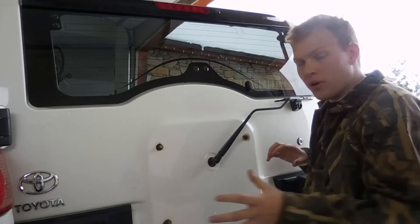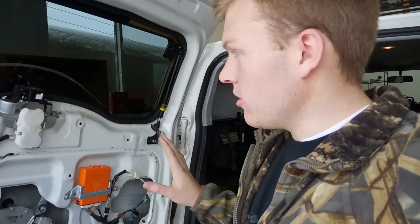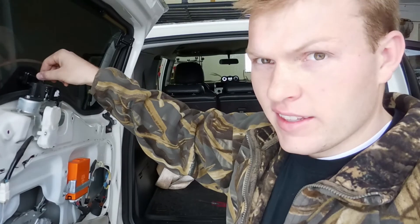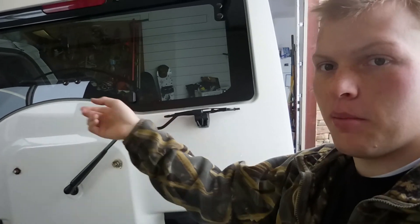From this point, I would take off the bolts and re-put on the rear tire. I would also make sure to re-install this plastic, putting it all back into its place, and then re-putting on the back panel and clipping it into place. Something I forgot to mention earlier: to take it off and to put it back on, you have to open the rear window because there's a part that goes right there with a hole for this bracket that is locked in place. So make sure you can open that window — you do that by putting your key in this hole, pushing it in, turning it, and holding it. After you hold it for a couple seconds, the window will pop out and you just pull up on this little tab to lift up the rear window. Hopefully that helped someone out there. It wasn't available information for me, so I just figured out what I had to do. Hopefully you don't have the same problem. Have a great day.